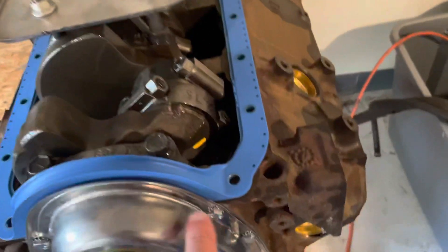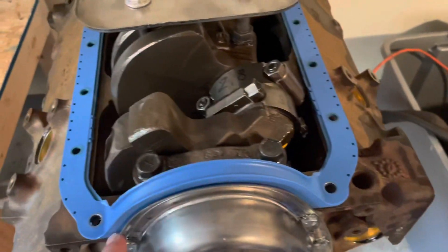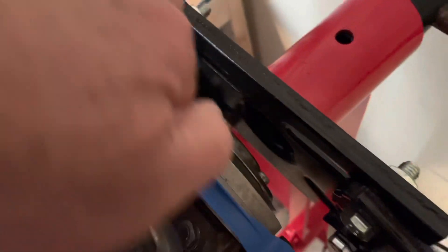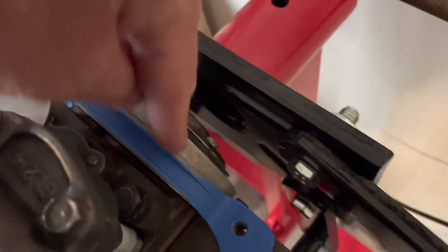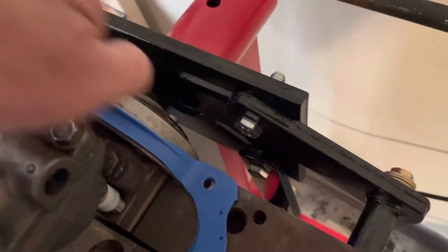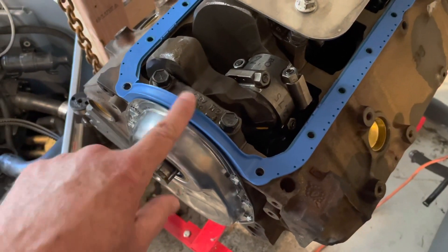At this time I'm going to put gray silicone sealant in this corner and this corner underneath. I'm going to put a significant amount right in there and smear it across the top. I'm not going to put it down the sides at all. I'm going to put some back in that corner, in that corner, and across the top of the rear main seal part there, and then lay this in there and put gasket seal on top of it too. I do that with all my engines — you don't have to do the sides because they're not necessarily prone to leaking, but you're prone to leaking at your corners and at your low points where the oil would settle in your oil pan.